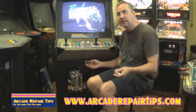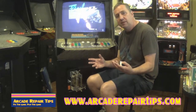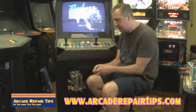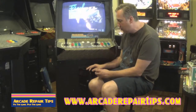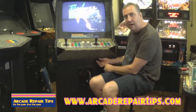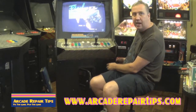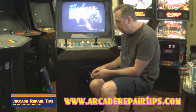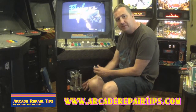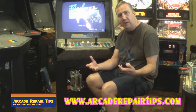My father in law likes to call them a sneaky switch — where it would be a little less visible to everybody else. So whatever your preference is there. But that would give you an option to where you don't have to have the coin door open. We can have the button mounted here or wherever we choose to — even on the side of the game. And then every time that you push that button it would essentially do what flipping the switch does, so flipping the switch and pushing the button would be the same thing.